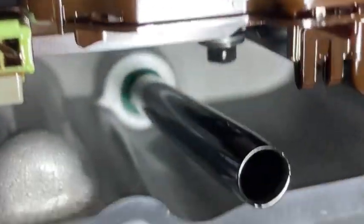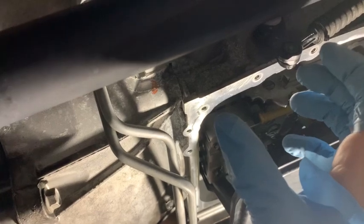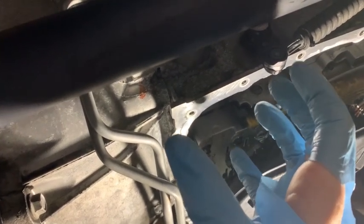I wiped it off a little bit here already on the flange. I'm gonna wipe it off one more time and wipe off some of this fluid on the exhaust here, which I'll try to get to, because it's easier to get to with that pan off. So I'm gonna try to do that real quick before I put the filter and pan back on there. So the new filter goes in like that. Obviously the spout is right there toward the front and then the body of it toward the back. Now when you get it, you can start walking it kind of up in there. I pushed it up straight just to kind of get it started, then walked it in there,